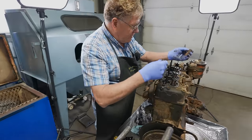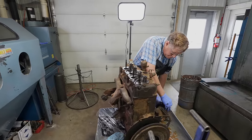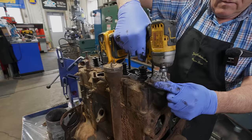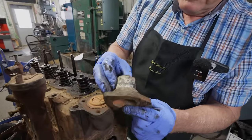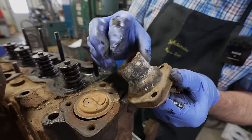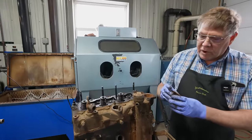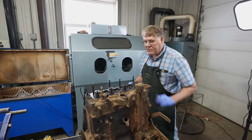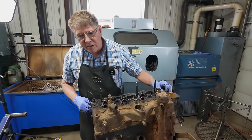That one is twisted off. I'll take the oil filter canister off here and the thermostat neck off while we've got it here. Wow, it's really dry — quite corroded. We can probably clean that up and make it work one more time, but if we could find a better one we would, where that's eroded so bad. I have a rule in the shop here that regardless of how good thermostats and spark plugs look, I always throw them away so the customer has to buy new ones. That way there's no chance of an old thermostat going back on a good engine and ruining it.